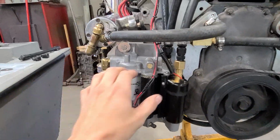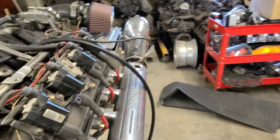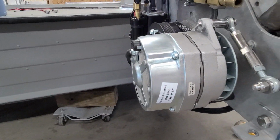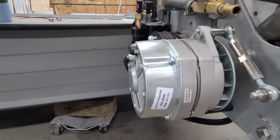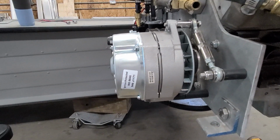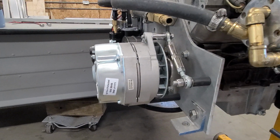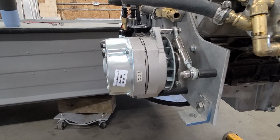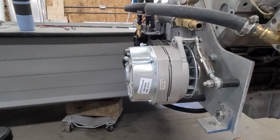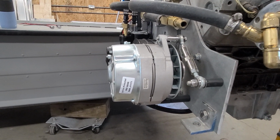But so this is back on the alternator here. One of my dedicated viewers made a good point about this. This is a crappy, like, it's a marine version, but it's a crappy old 10SI. And I used to put these on, everybody does. I think you put them on equipment all the time, old diesel equipment, because they're really simple. You know, the factory Motorola alternator would burn up on some portable air compressor or generator or something like that. And those things are, you know, $300 to replace, where you just throw those away and slap one of these Delco one wires on there, and there's one cable.